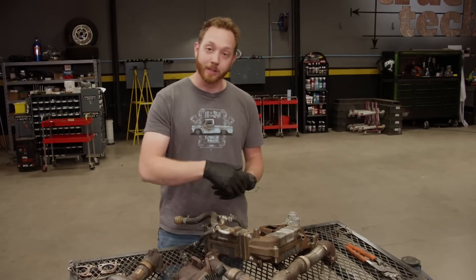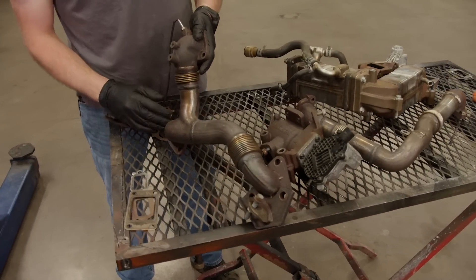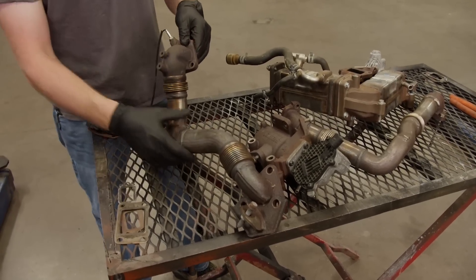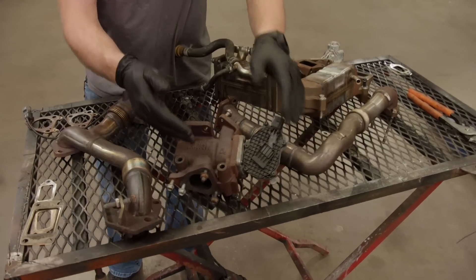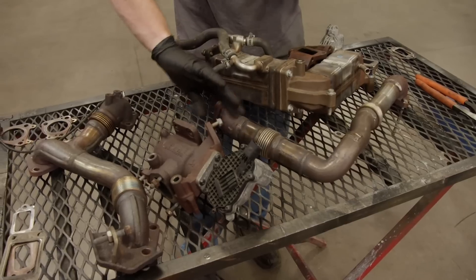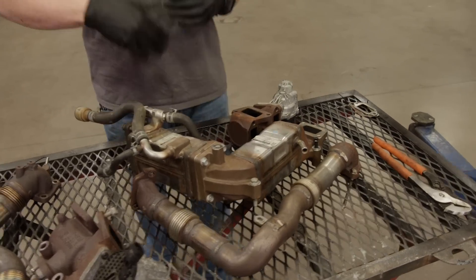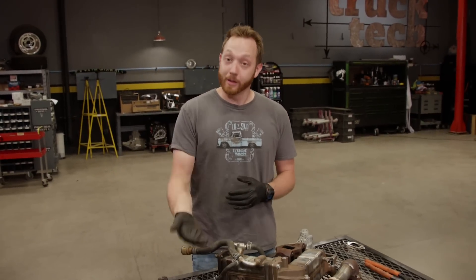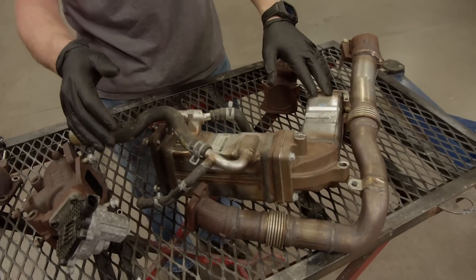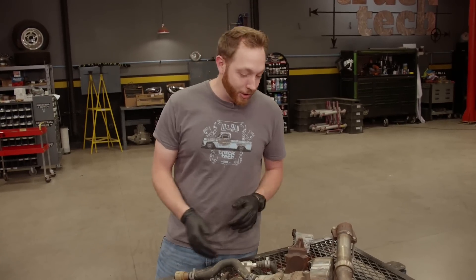There's a lot going on here, but it's actually quite simple, the path that the exhaust takes. The uppipe connects the exhaust manifold to the turbocharger — that's where we want most of the exhaust gas to go. However, a small percentage is diverted into the EGR system. The first stop is a valve which controls exactly how much exhaust gas proceeds on. Because the temperature of the exhaust gas is so warm, it first passes through an EGR cooler which reduces the temperature. The hotter the exhaust gas entering the engine, the more temperature of combustion is going to be, and therefore the more pollution it creates. So as we lower the temperature of the exhaust gas, we lower the temperature of combustion, which reduces the harmful pollution. We're happy to reinstall it — it just takes a couple extra steps.